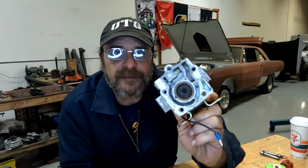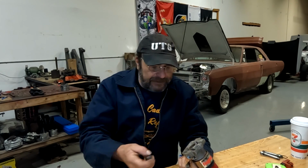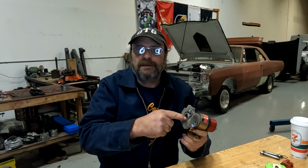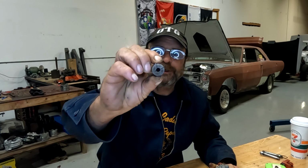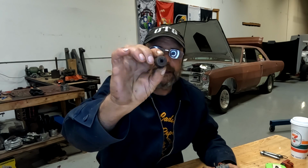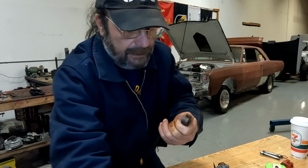Now you look inside there, and you can see how rusty it is. And that's from the fuel, and especially ethanol gas, that lays at the bottom of the pump, even after you drain the system, and it will rust. As it deteriorates, it rusts, and it gums up the inside of the pump. So this is the actual functional part of the pump. The electric motor is spinning this. This is a rotor assembly, and inside the rotor, you have these vanes.